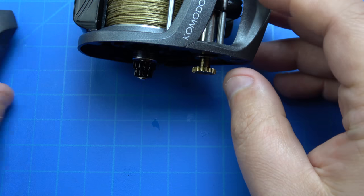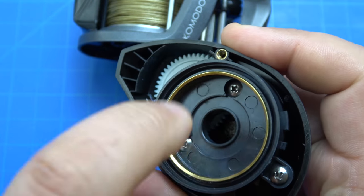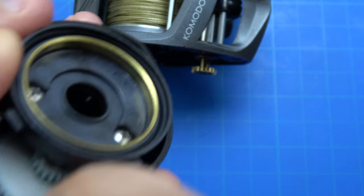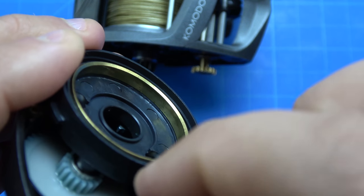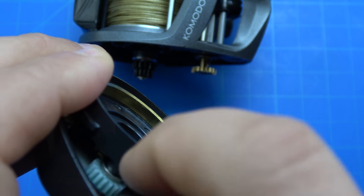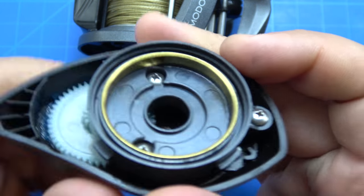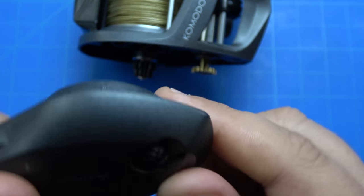Whatever you prefer — I'm sure the fish won't mind. Then you have what goes on in here. So what you'll do is remove this screw, this screw, and this screw. This lifts out very straightforwardly. Once you pull that out you have access to the idler, which is in here. What you want to do is degrease the idler and degrease the bushing that it runs on, and you're just going to apply oil. While you're in here make sure you don't have any residual oil left on this centrifugal brake ring.